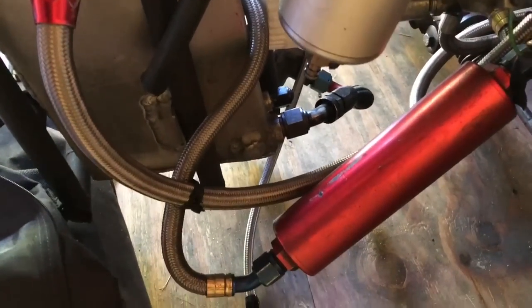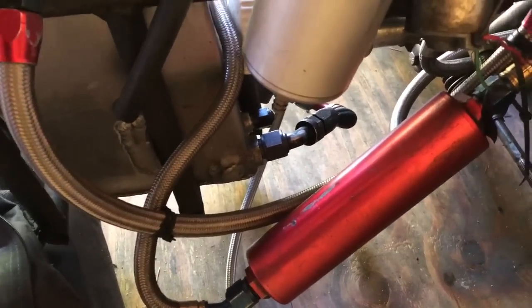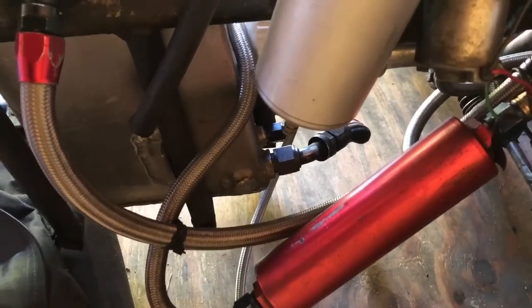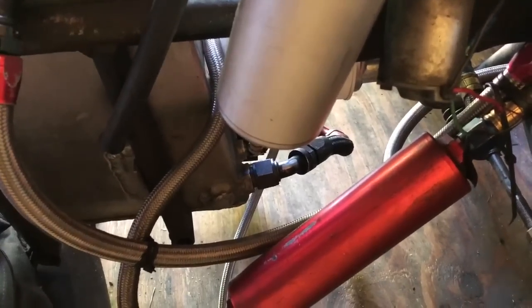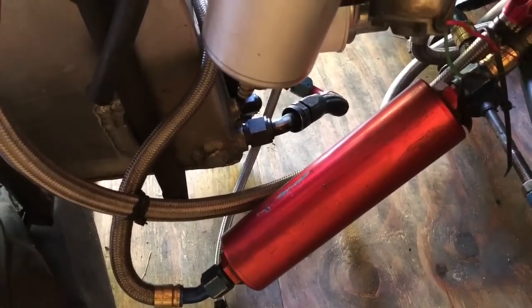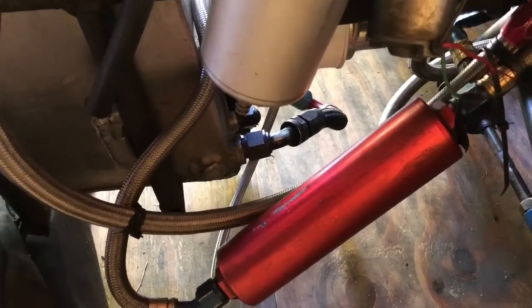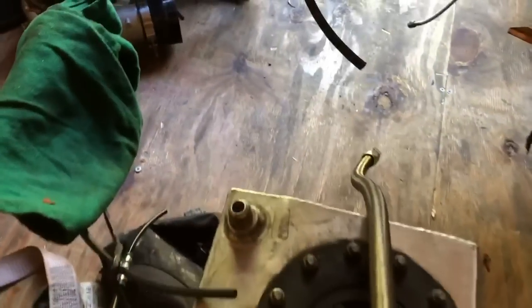Being budget-oriented, I have a fuel filter that came off a NASCAR car — I got it off eBay about 10 years ago. It's a Peterson inline fuel filter, 100 micron, and it's cleanable. It fully disassembles so I can keep track of any debris. I think it started life as an oil filter of some sort, but eBay was my friend. The number 10 line comes out of it and goes up to the intake.